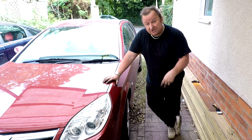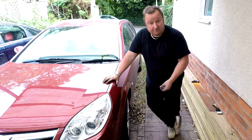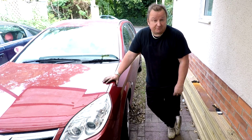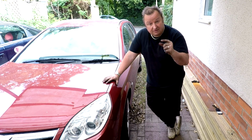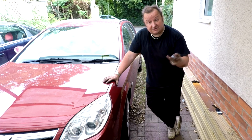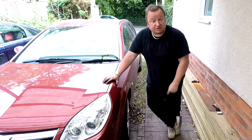So I've left them little bits in, as I always do, when you come up against problems and what could happen. Someone said you probably should never have used a 3/8 breaker bar. Well, I only had an E20 socket in a 3/8, so it undone the first nut, all right, the second one it snapped, that's my problem. That could happen to you too, that's why I leave these little bits in.